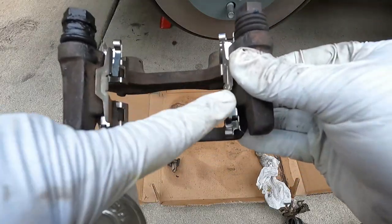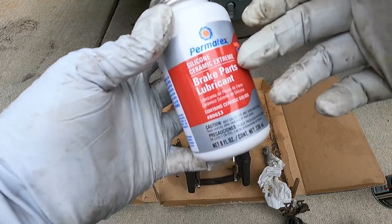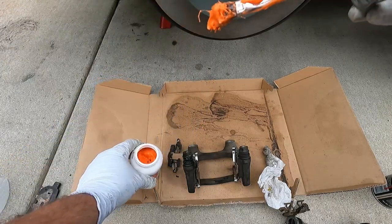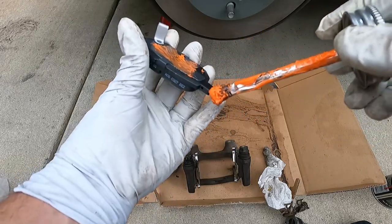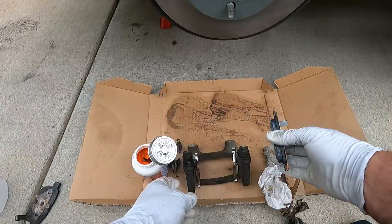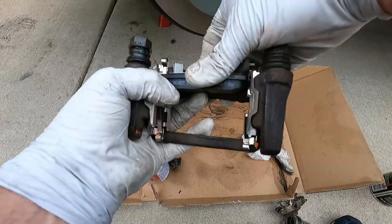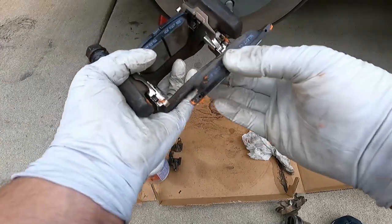This clip is kind of loose, so I think I'm going to load this up with the pads first before I put it on. I'm going to use a new grease by Permatex — it's the Silicone Ceramic Extreme. It's a much higher temp than the caliper grease that I'm usually using. I'm just going to use a little bit of this on the back of the pad and at the ends where it's going to slide inside that retainer, so it doesn't get bound up in there.